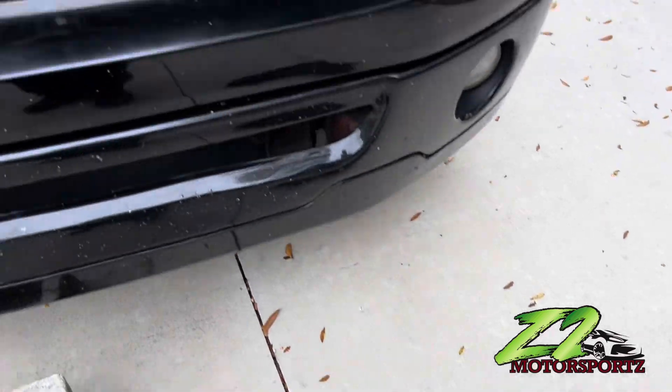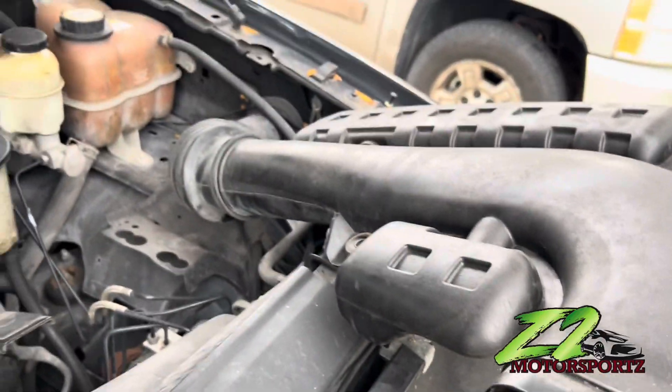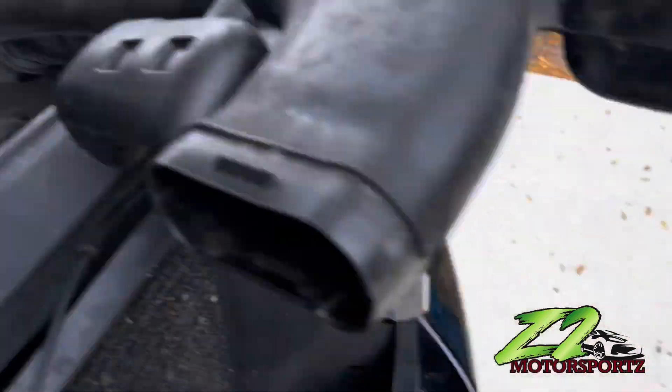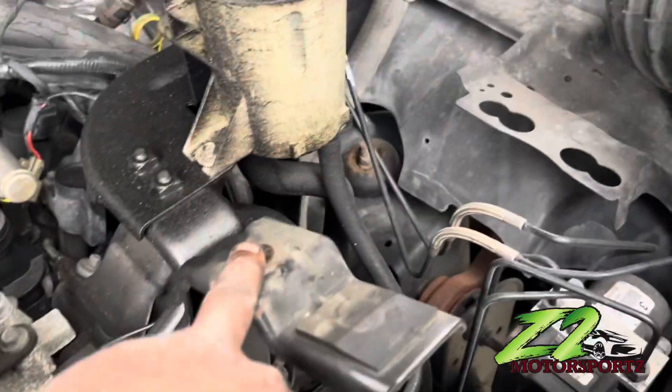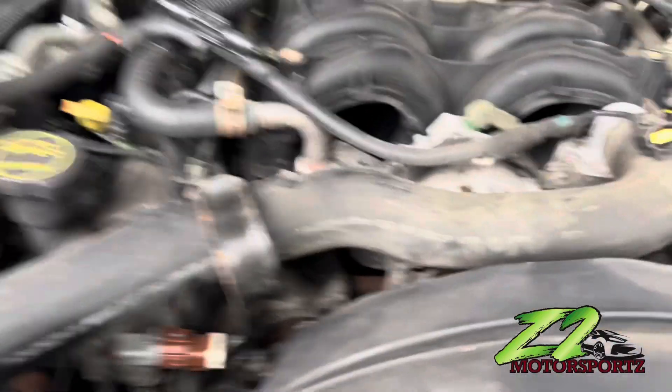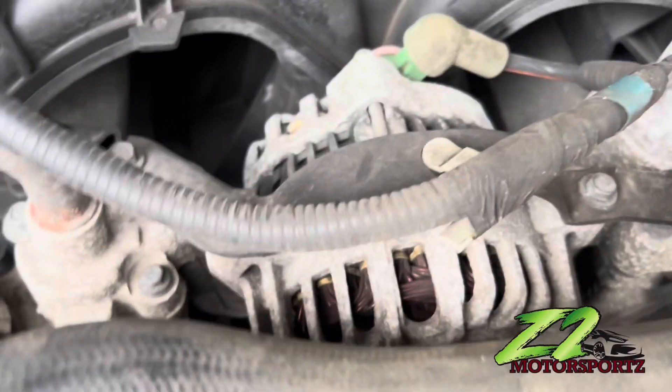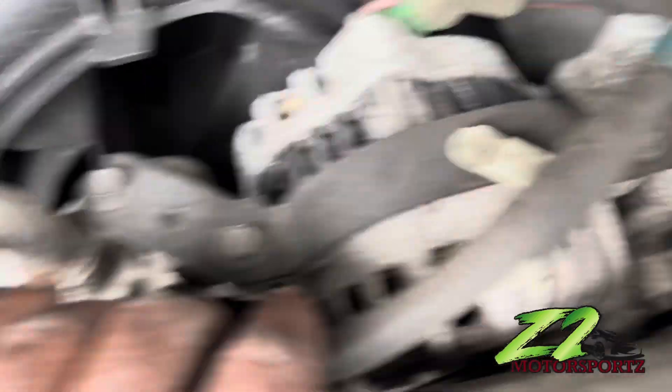I kind of started already and then I was like, oh maybe I should make a video. So listen, anybody who has a Ford, they already know — this is on the top 10 mil bolts. Ten mil bolts, one, two, three, four, that pops off. Ten mil bolt right here screwed into right here. That moves out your way. Now we're gonna need to get the serpentine belt off to get this alternator out. Alternator has eight mil, ten mil bolts there, and then we got some 15s on the bottom.